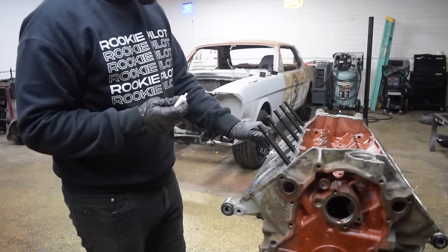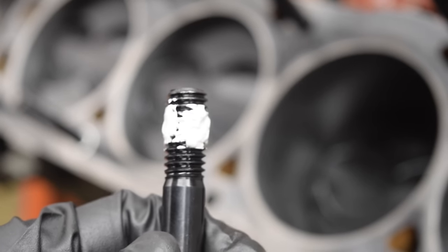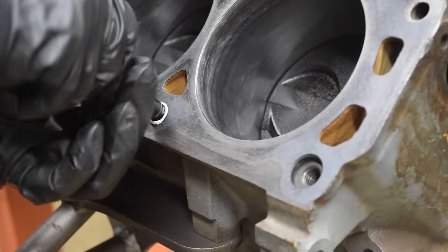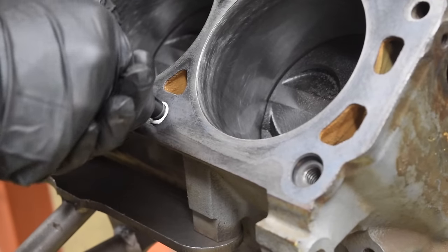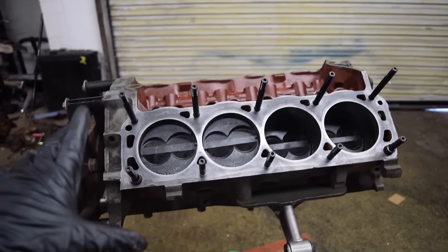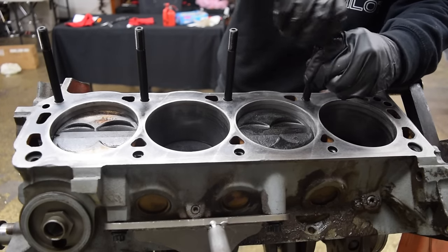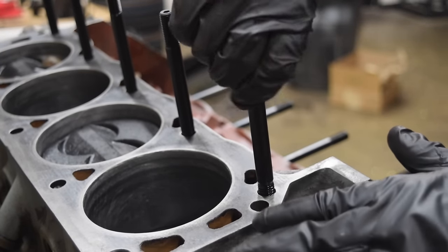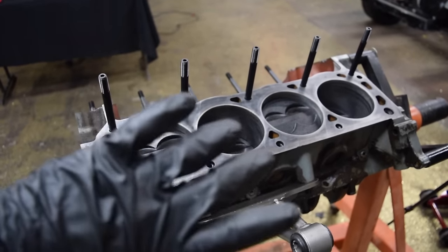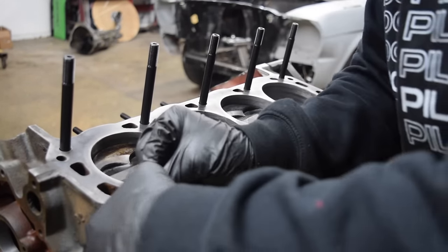It already outweighs the cost, so technically we are saving money — or at least that's what I tell my wife. I'm also putting a bit of thread sealant on the lower ones because these bolts go into the water jackets for the coolant. It is also recommended to use a fastener assembly lube, which is different from the engine assembly lube we used in the last video. Our head studs are now installed on the passenger side. Another reason people might not like using head studs compared to head bolts is that the head gasket and head bolt are an engineered fail point — meaning that if there's something wrong with the engine, that head gasket or head bolt will fail to protect something else from failing.